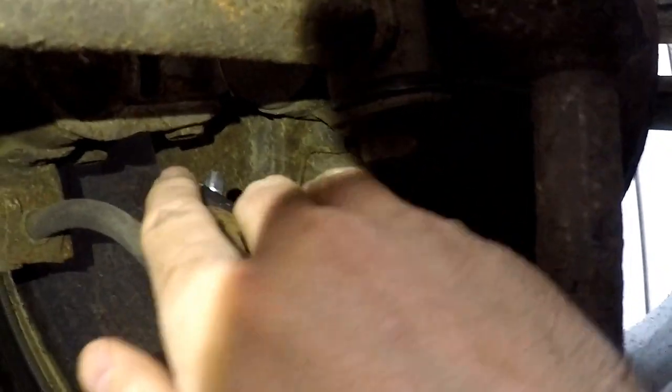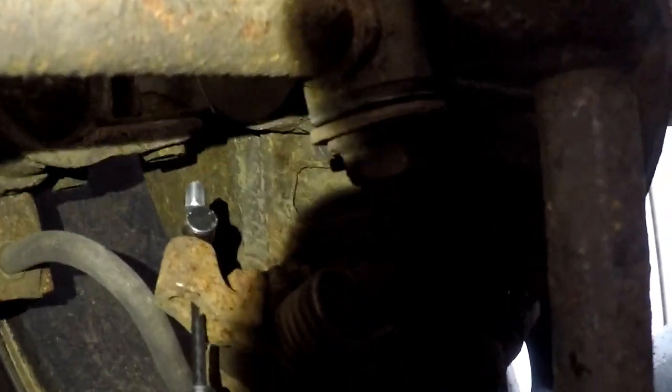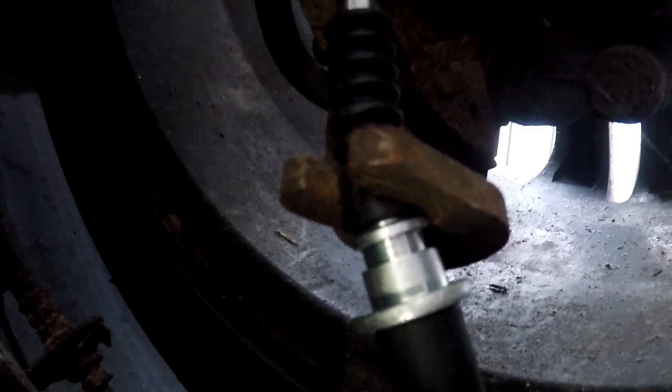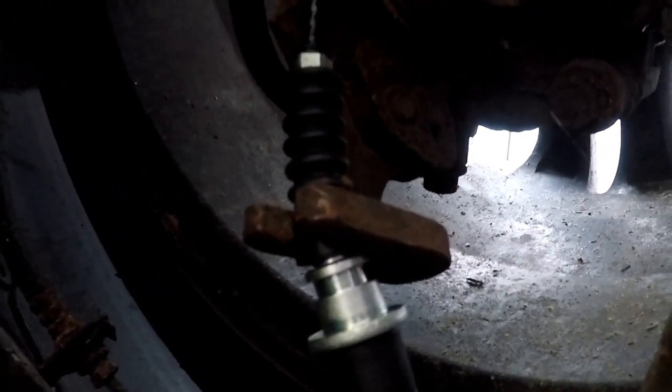Like so. Just like that. And then spin the drum so that it rests in this pocket. Push it down right in there. Perfect. Okay. It might come out. If it does, no worries. Now you're gonna slide the rest of this piece in just like that. I might need two hands for this, but basically you're gonna push it up so that this silver piece is resting right in that clamp, or right in that bracket, and that's really all there is to it. So we're gonna go ahead and get that done really quick, and then we can go ahead and adjust it.